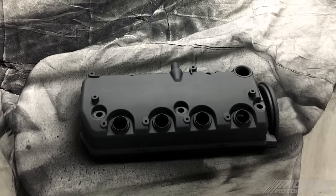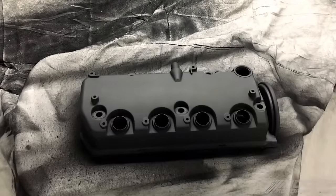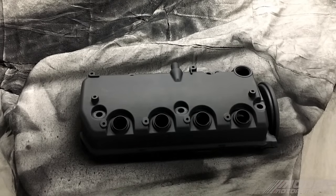Before we get started, I just wanted to tell you, I used these 20x20x1 filters on the back of a box fan to pull the fumes out, so that way we can get the fumes out of here. Now, the normal spray paint is not so big of a deal — the fumes aren't too harsh. You will need a respirator either way, and be in a well-ventilated area if possible. But when you get to the 2K, that stuff is pretty strong and very dangerous. So you'll want to make sure that it is definitely filtered out and that you have plenty of airflow wherever you're painting.